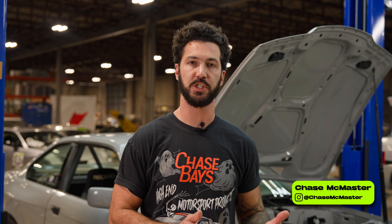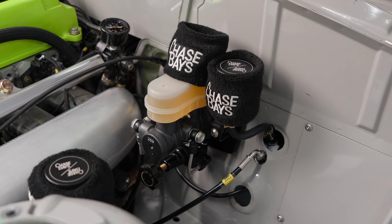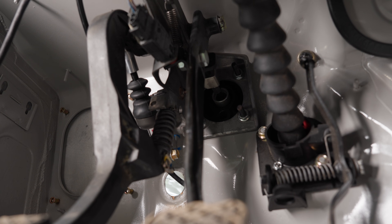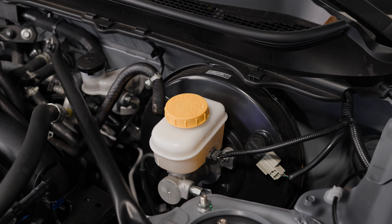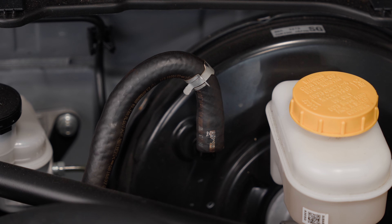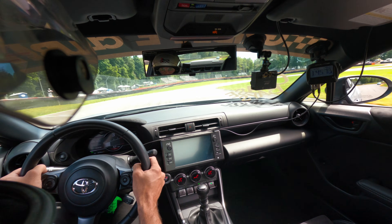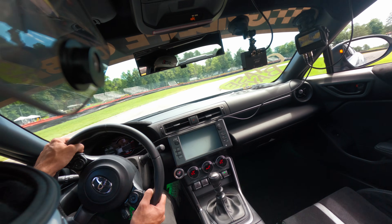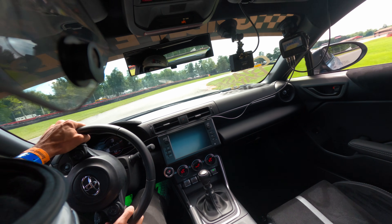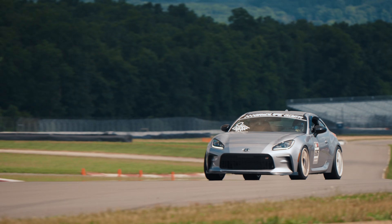You may be wondering why you would want to change to manual brakes on your car. A manual brake can create controllable and consistent braking for the same experience every time. Unlike power brakes, which are vacuum assisted, the pedal throw is different every time — one inch would be 500 psi on one push and then 800 psi on the next. That inconsistency makes everything slower.